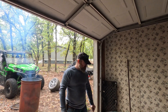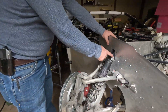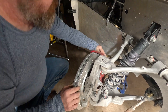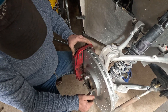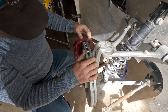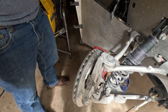Been a little bit, but we got a little bit done here as you can see. We've gone through and checked the torque on everything — all these pieces have been checked and torqued. We've got the new rotors on here; I am questionable about their directionalness. These are the C6 calipers — the big six pistons on the front and fours on the rear — and we got new pads and all that good stuff.